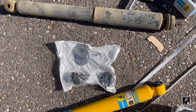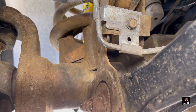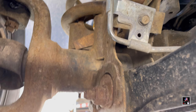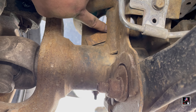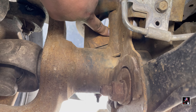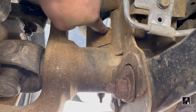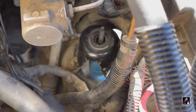We go in reverse order just like we did on the rear. Use the screwdriver to help you line up the hole, stick the bolt in, and then the nut is on the outer side — just push it in, line it up with the bolt, and tighten it down. Flat side goes towards the shock, then just tighten it up.